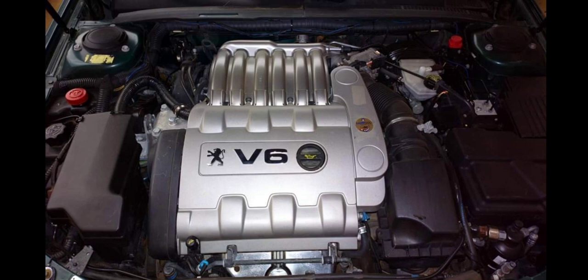So you will have to remove all the plugs and get rid of that water before you start. In that case, before you even start washing the engine, you must block that hole between the thermostat housing, the intake camshaft chamber, and the exhaust camshaft chamber. You see a small passage where water can actually flow from that thermostat housing into that place. If you don't do that, you stand a chance of losing that ignition coil, or you have to engage a mechanic to pull out your ignition coil, pull out your spark plugs, and remove the water before the engine will run very well. You don't want to do that.